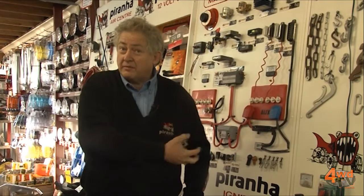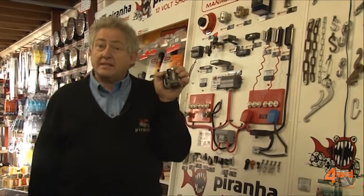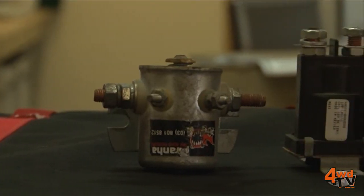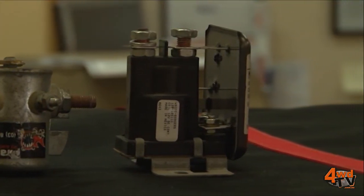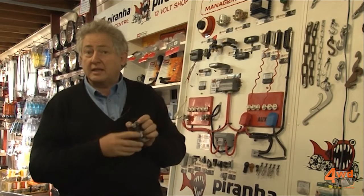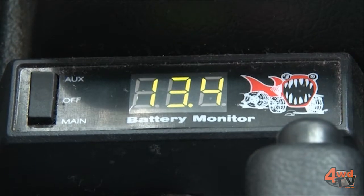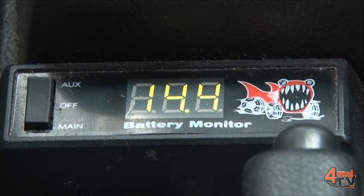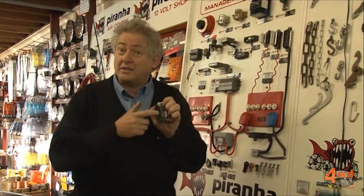What is a smart solenoid? This gadget here is basically what we call a smart solenoid. It still has a solenoid, except instead of a tin can it's a plastic one. It still joins the batteries together in parallel — it's like a big switch. But instead of just an on/off switch, it has a little piece of electronics built into the back with some sort of voltage sensing, so we have to wait for the battery voltage to reach a predetermined threshold before it switches. It's smarter than your average solenoid, but it's still a solenoid.